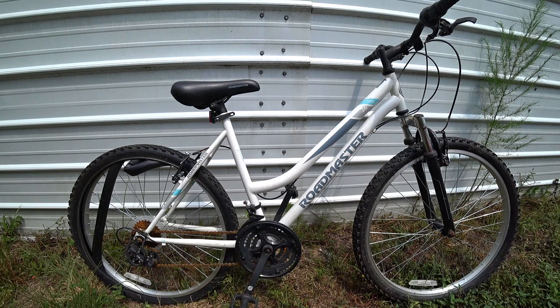I thought, well, I'll try it — I'll get a drill and a threader and some grease fittings. And it works great. It will make your bicycle pedal easier and freer, and when you're coasting it's amazing — it seems like it'll coast just about forever until you start going up a hill. It's amazing how much more free your bicycle can roll when you can get a grease gun and put a little fresh grease in the hubs anytime you want, instead of the grease getting worn out and having to take the hubs all apart.